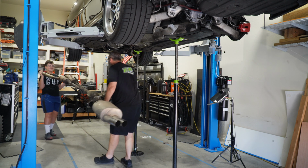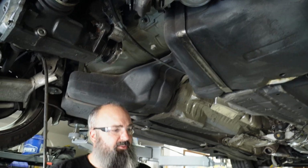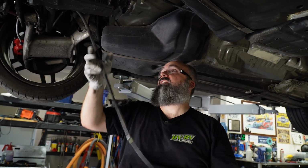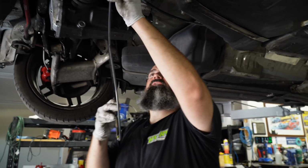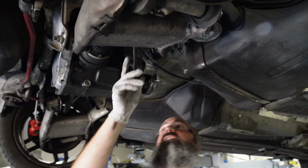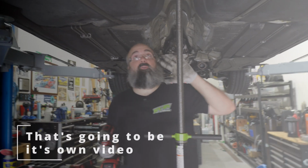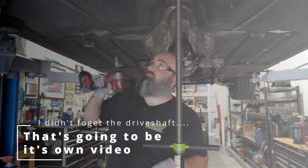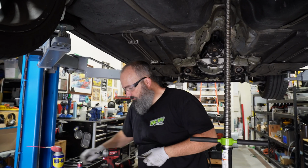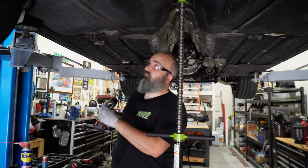Those things are dangerous. So the reason they wouldn't come out is because with the handbrake up, this won't make the bend. So I put the handbrake down, these come out no problem now. We'll just stuff them side to side, out of the way here. So our 4 mounting screws or mounting bolts are 5mm Allen heads, 2 for the straps and 2 for the wings on the side.